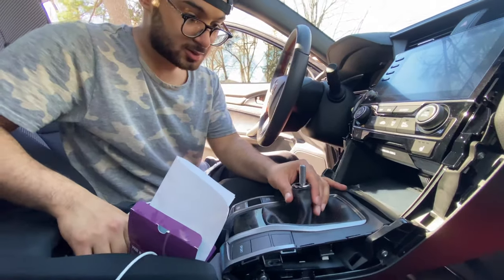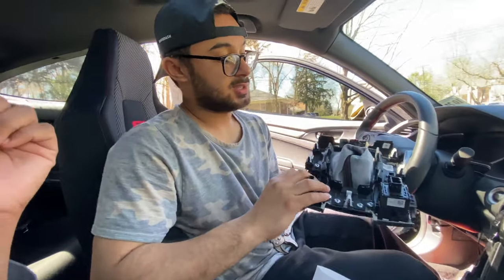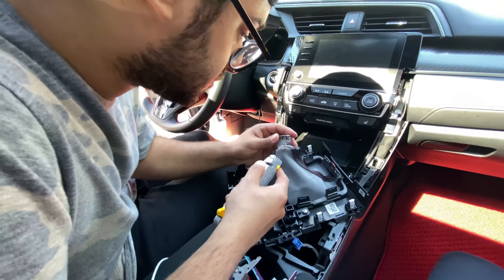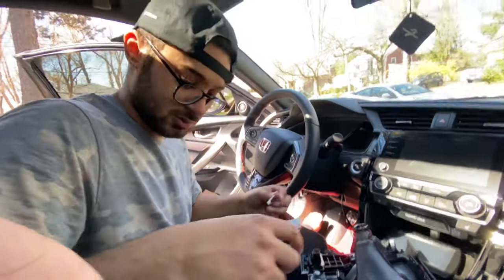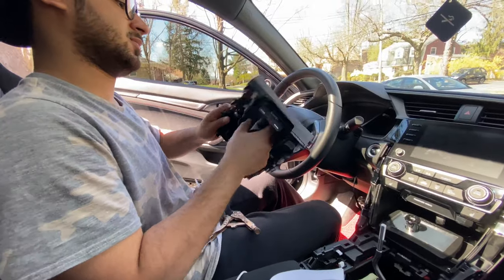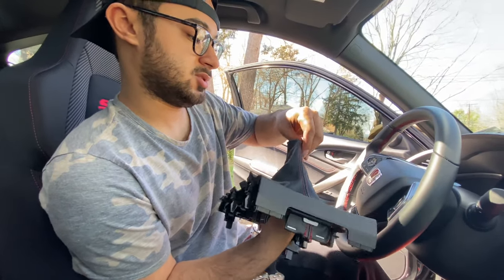Go ahead and twist this off. For now, make sure to keep this inside. So once you get everything up, you can go ahead and move this out of place. As you look at the shift boot here, what you're going to want to remove is this part here. You're going to want to clip this with a sort of pry tool or something sharp, so that way you can put on the new shift collar and zip tie. Go ahead and carefully clip the side of it — look for a loose end. Once you find the means of taking this off, go ahead and take this little bad boy off — it's going to be the old one. So once you have everything set here, you're going to want the shift boot to look a little like this — you're going to want it inside out at this point.